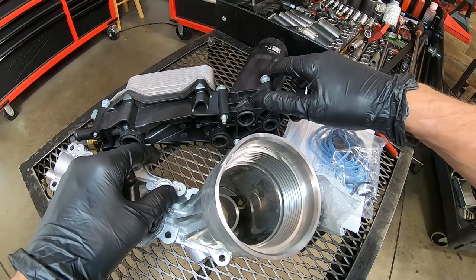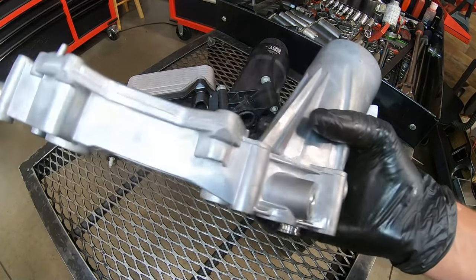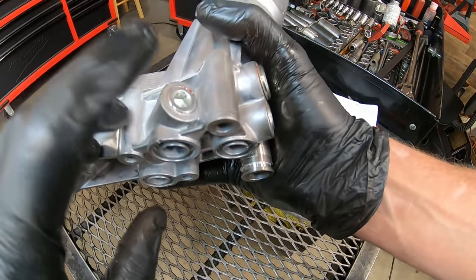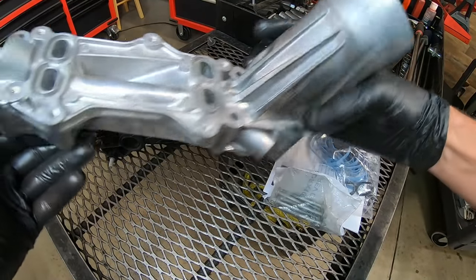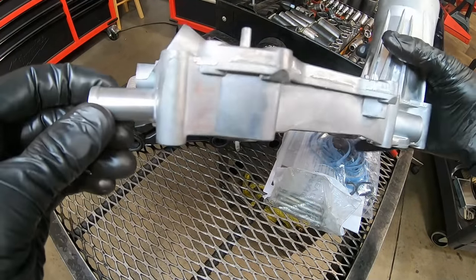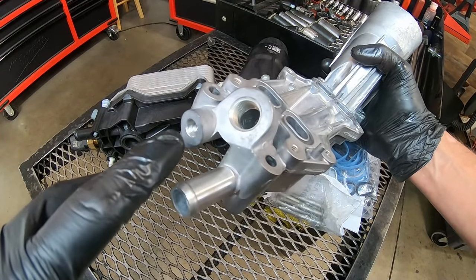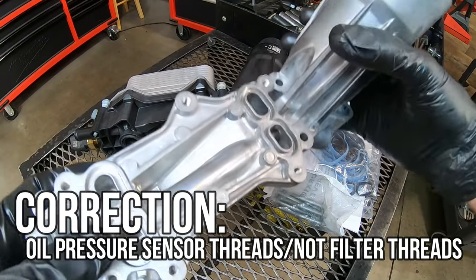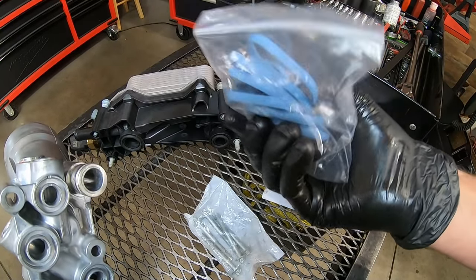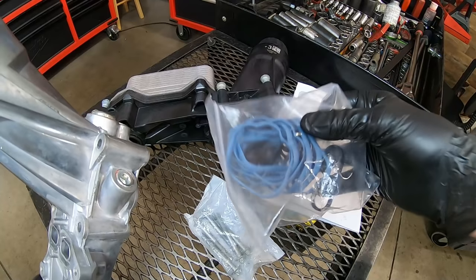After years of replacing these leaking oil filter assemblies and these things being on back order numerous times, Dorman finally stepped up and came to market with their one-piece aluminum design. We don't have any possibility of a port blowing out because these are threaded and they've got sealing on it. Made out of aluminum, we don't have the issue with the wall deteriorating, collapsing, and having an external coolant leak. We'll never have an issue with this nipple breaking off. You've got your oil filter thread, your oil temp thread, and you've got everything you need to install this. It comes with the fasteners and all the seals — not only for the bottom of the cooler assembly, but for the upper and lower intakes. So all the seals you need for doing the job.